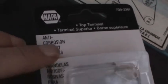They really do work wonders, especially on regular flooded batteries. But I think it looks pretty good in this truck. It should add a lot more ruggedness to the vehicle. And I didn't make a very long video about this. It's actually a very straightforward process. You just take out one bolt and loosen the terminals and you're done. And of course, when you put the terminals back on, you want to do the positive terminal first and then the negative terminal last.